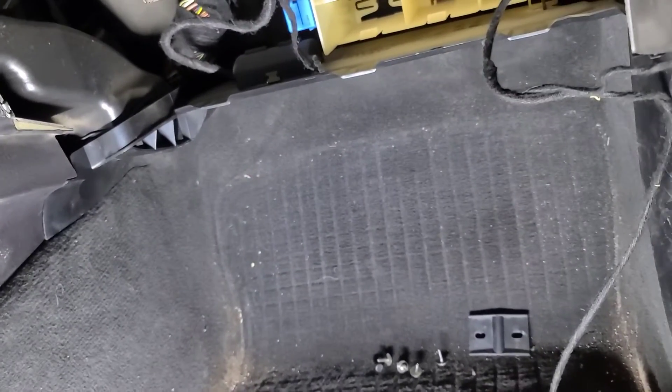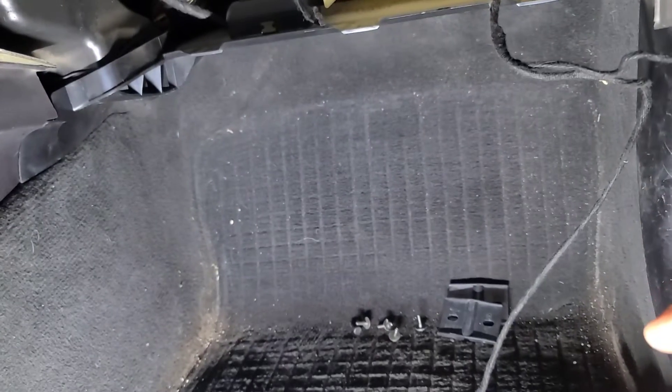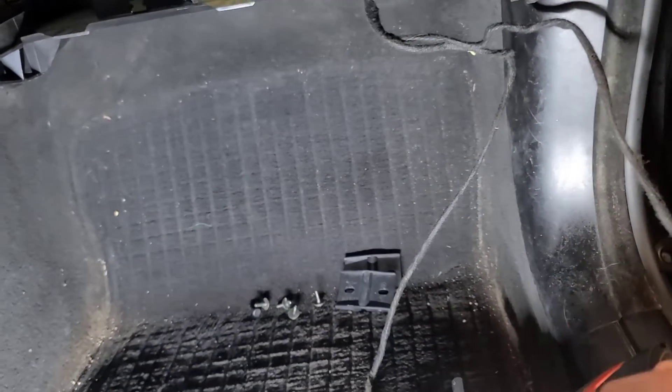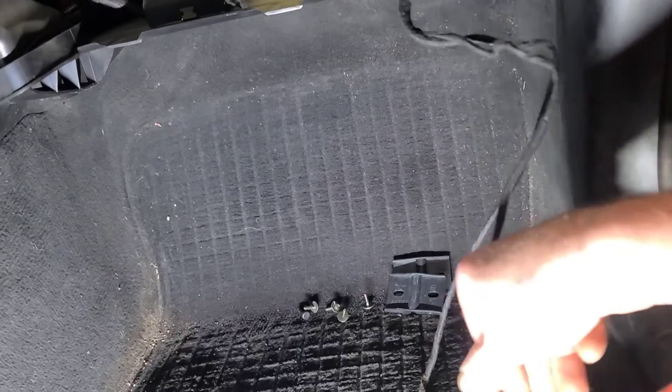You have to remove the glove box. There's four screws and little hinge brackets on the bottom of the glove box. Keep those screws separate because they're a little shorter than the ones around the glove box housing. And then there's two little rods that support it on each side — little plastic pins you have to pull out. Disconnect the two wiring harnesses and move it off to the side.